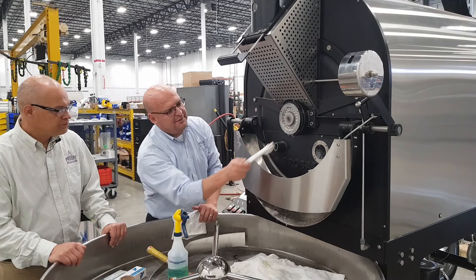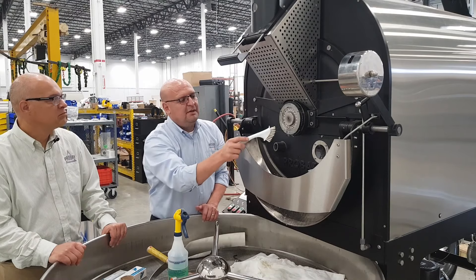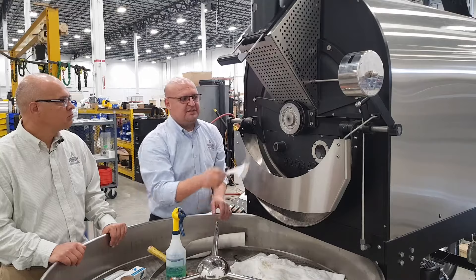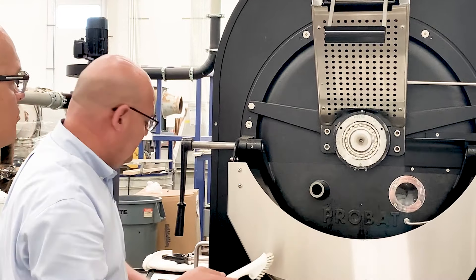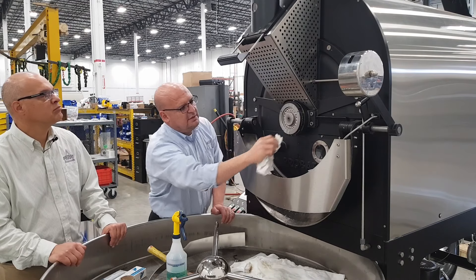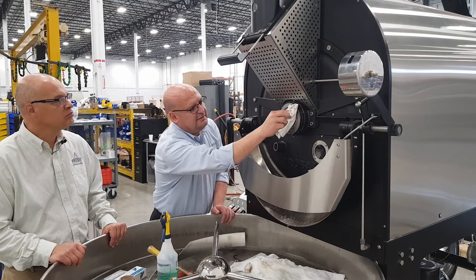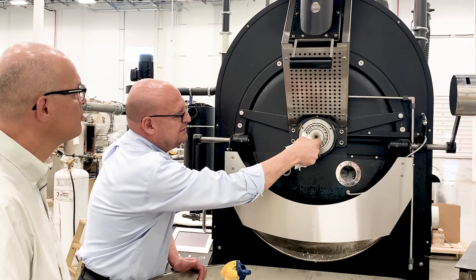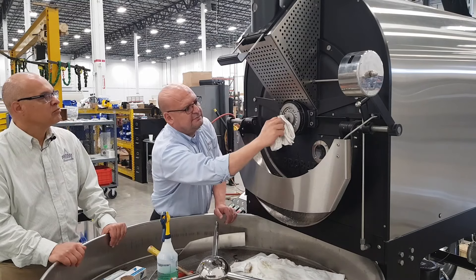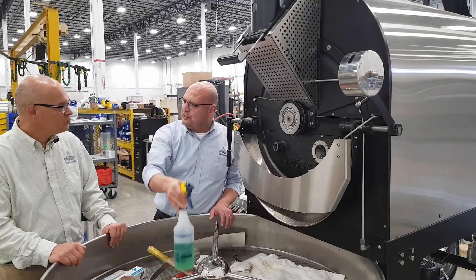This is coming out clean. I want to use this opportunity to say: when you do your unit, this is going to be oozing like a cup of joe. But if you notice mine — because it's good grease — it comes out clear. That's kind of what you want when you're cleaning yours: to see clear stuff coming out. That means your bearing is now clean. When the bearing is finally clean, you're going to be able to see the ball bearing. Seeing as this is good grease, I'm going to repack it — so I'll turn it off.